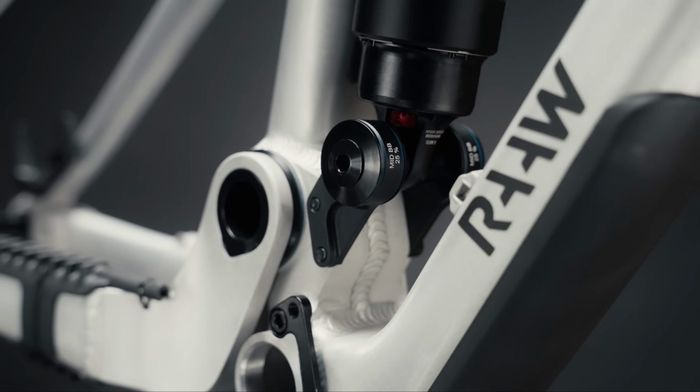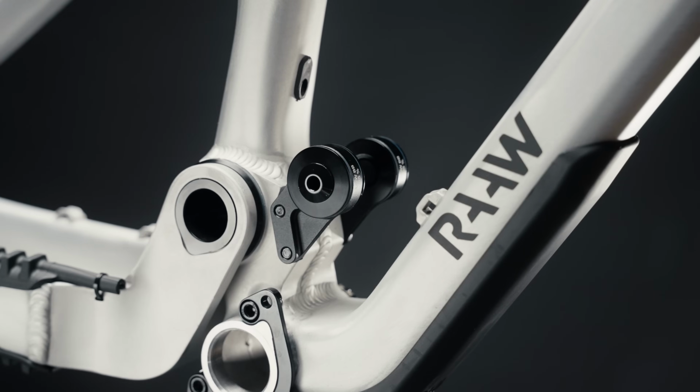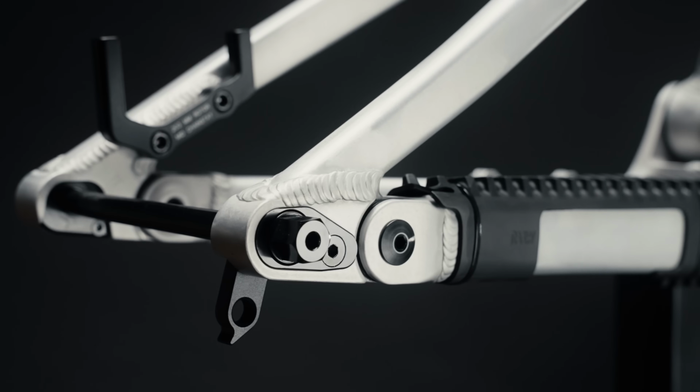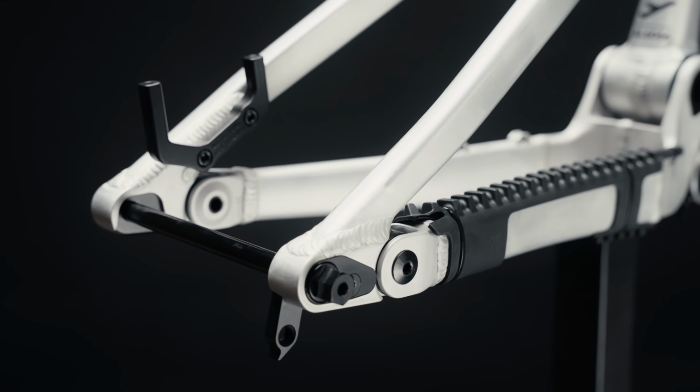The toolbox concept from our Yala downhill bike now finds its way into the Madonna. We used the exact same lower shock mount from the Yala on the Madonna to adjust the BB height by 3 millimeters up or down, and also offer progression adjustment for the suspension. The rear wheel axle comes in a mid position and can go 5 millimeters shorter or longer with different axles.